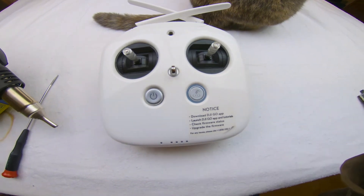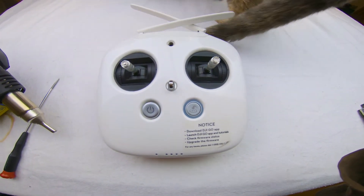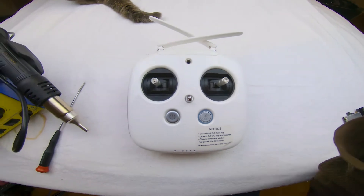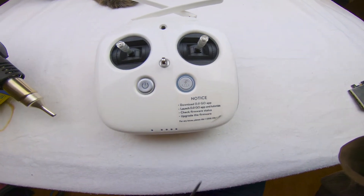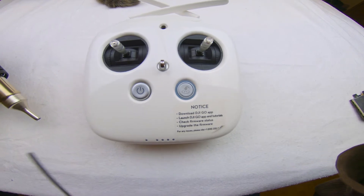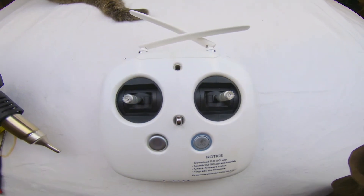This is from the DJI Phantom 4 Pro. Many of the DJI products had this problem. The battery in this thing will not charge. I saw it progressively go from bad to worse. Charging used to bring it to two to three bars, then it was down to two bars, then one bar, and then it wouldn't charge at all. This thing would flash and just beep all the time.